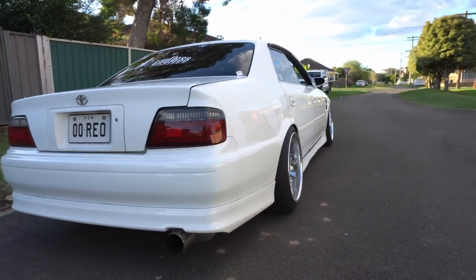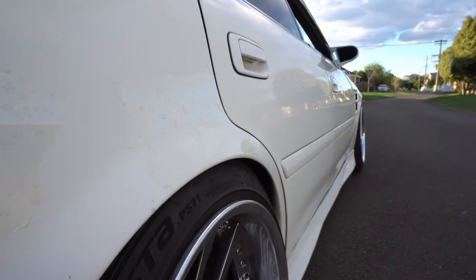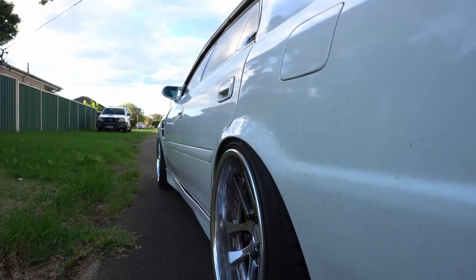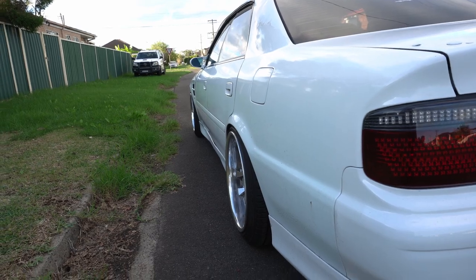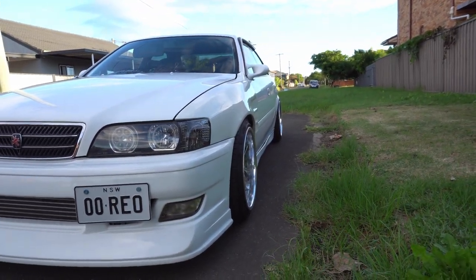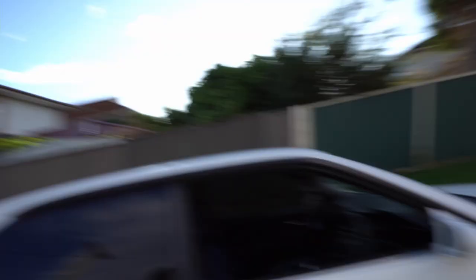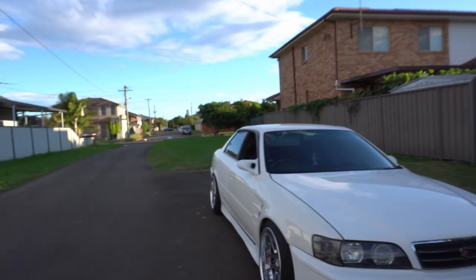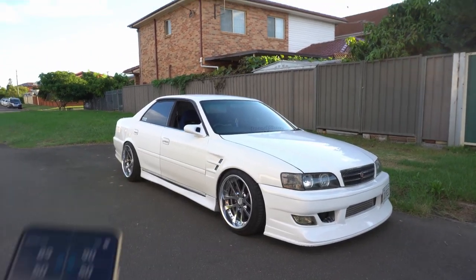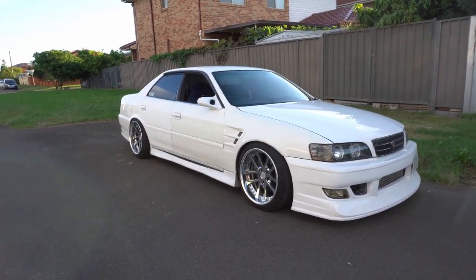With drive mode, this is the one we obviously want to perfect. The roads aren't that straight but this is how low I've got on the rear — sometimes if the roads are straight it will be just above the lip, which is already pretty low. The rears were so perfect that we didn't really need to change anything — it was already in the right camber setting and it's not going to hit the guards; it's pretty much tucked. For the fronts it's not really where I want it to be — I'd like to poke out more in the future. We reduced the camber from the camber tops — it was on minus six, now we've got it back to minus two — just so when we air down you can see why: to achieve closer from the lip to the guard.